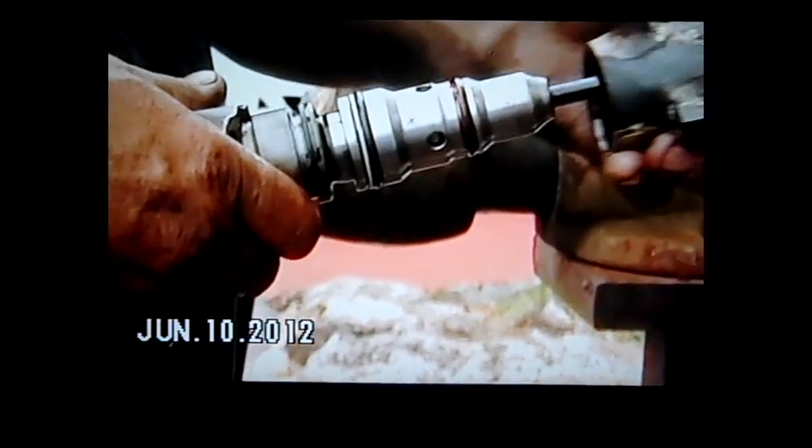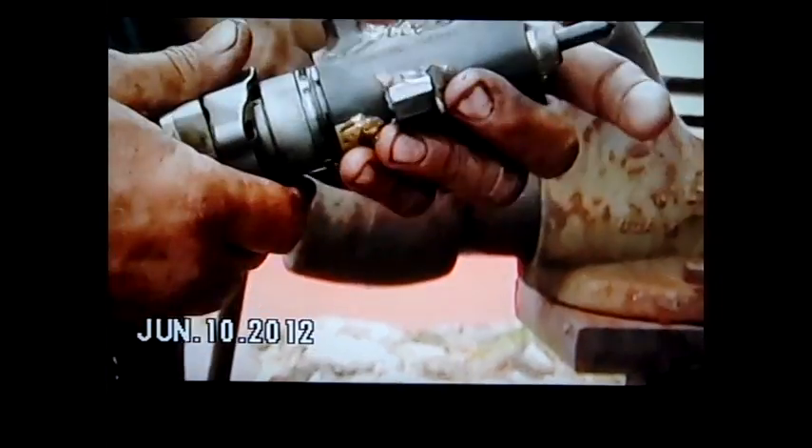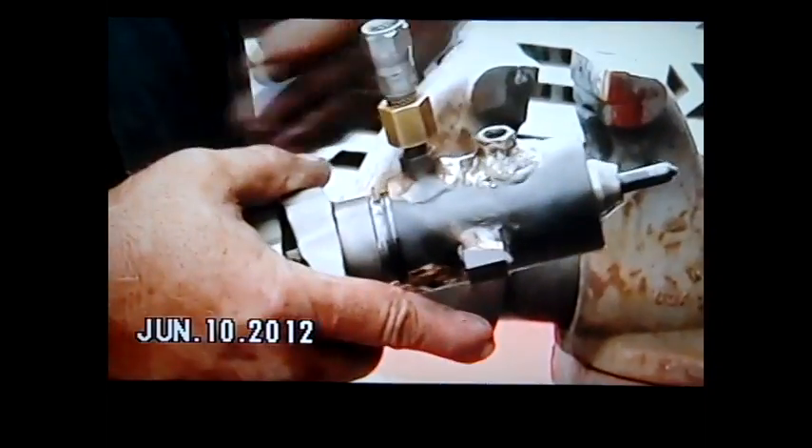It's pretty simple — you just slip it on. There are bolts here for checking the ICP, that's like 3,000 plus psi, so we don't have to bolt it for this test. 60 psi is not going to cause any separation. We get the injector sealed in and we're ready to check for any air leakage out of the injector tip.